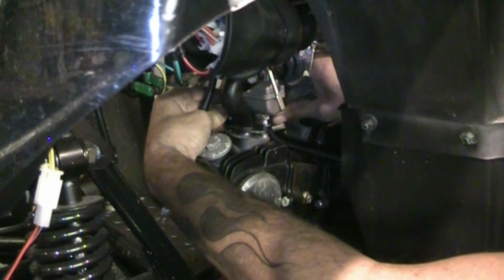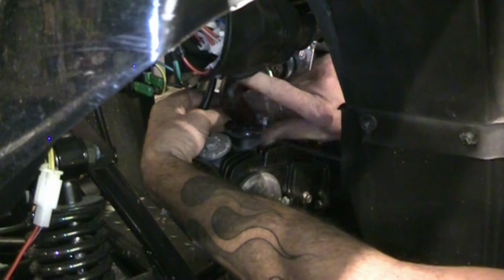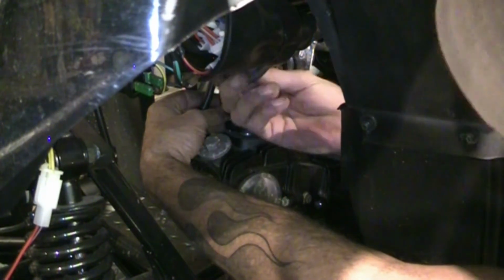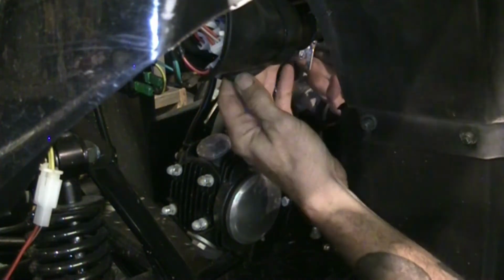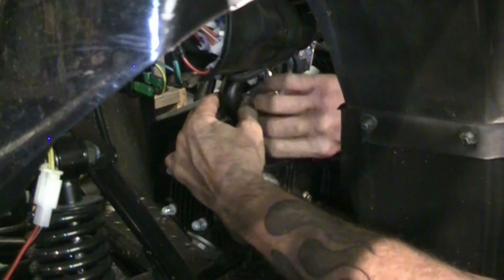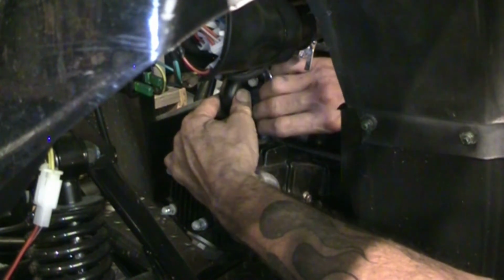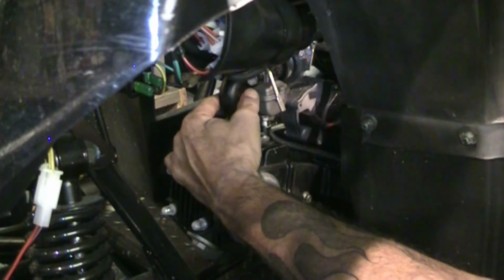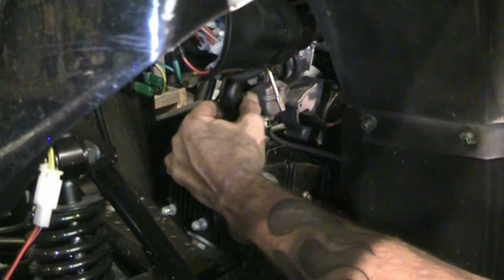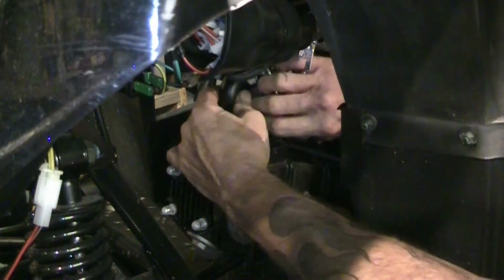There's a little vent line. So there's a fuel line that comes down from a fuel filter under the tank here. There's a filter right here. Oh, there's a bit of a kink in that line. That may be an issue. We'll see. So there's a line that comes down from the tank to a filter to another piece of tube that goes on the side of the fuel inlet. There's another hose back here that runs into a filter that runs to the crankcase for ventilation.